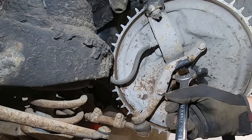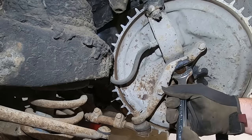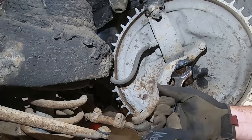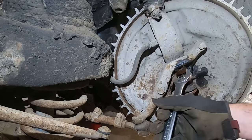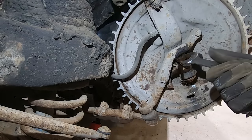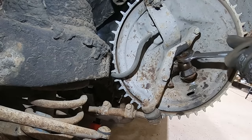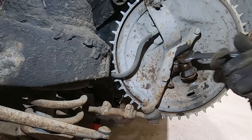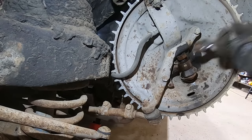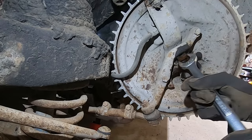If we're lucky, this nut will push against the steering arm and push the top half of the ball joint right out of the spindle. We're usually not very lucky though. If it weren't for bad luck, we'd have no luck at all, right, Duff? We'll either strip the top half of that bolt off, or it's pushing it out. I think it stripped the threads out, personally. What do I know?